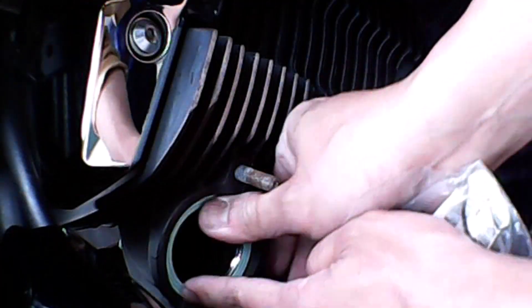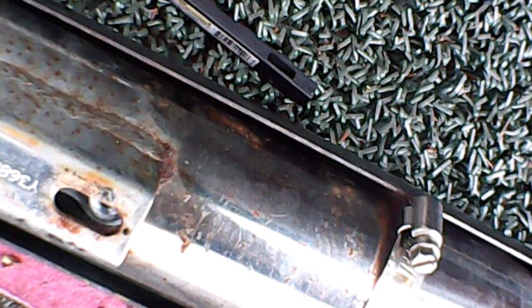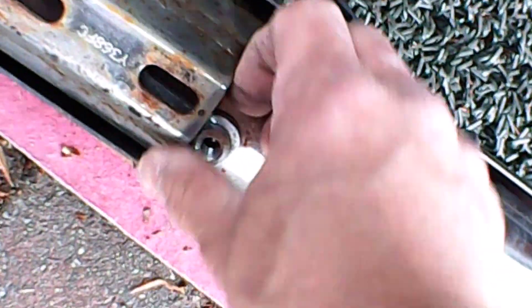Look at this one pop right out. I'm assuming the reason the exhaust was like that is because I didn't use new gaskets. What just happened is sort of a good thing — the brackets and nuts on the back just broke on their own, which is okay because they were already broken. That means I can now take these to the shop, find out what nuts would fit, see what size that bolt is, and get some new hardware.